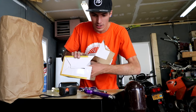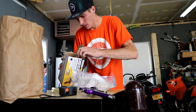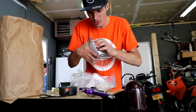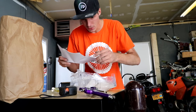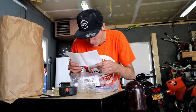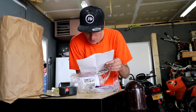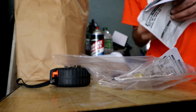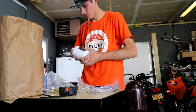I'm getting to the point where I have to build my paint gun and read my instructions to make sure everything goes well. I know how to mix my primer, I know what kind of gun I have. With this gravity feed gun, I'm going to apply two medium coats at a distance of five to seven inches with a five to ten minute flash time between coats, and then I'm going to clean the gun. I'm basically setting myself up for success.